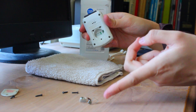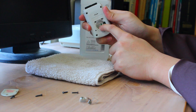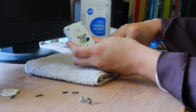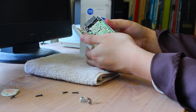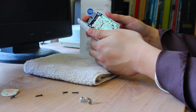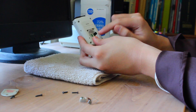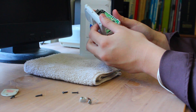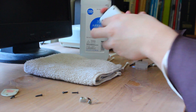Now, you could have cleaned those things without taking apart the VMU. The reason I don't do that is because the PCB board is right there. If you try to take your Q-tip and clean it while assembled, the excess alcohol tends to get right into the board. What that does is it basically prevents the VMU from working correctly unless you leave it to dry. But because once the alcohol is inside the case it takes way longer to dry than it should — probably like a day or so — that's why I highly recommend you clean the contacts outside of the VMU.